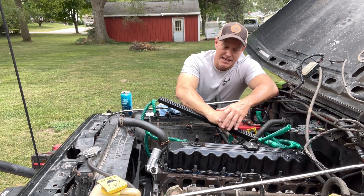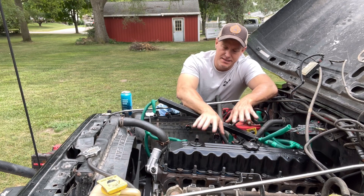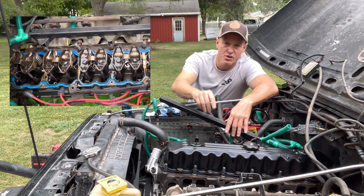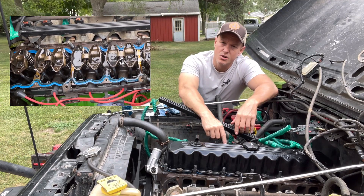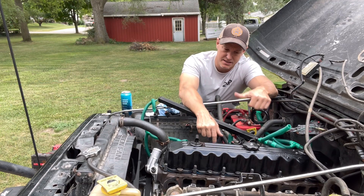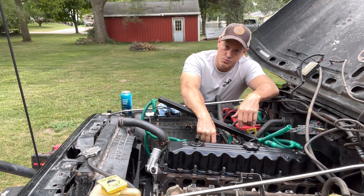It only had 20 miles on it. So what I'm thinking is that the spring on it was just not good. So we're taking the top half of the motor apart. If you look at the video, it'll show you right here — the lifter valve is not opening and closing. What we did is we did a hand crank on the motor, and the lifter was lifting inside because I held down the push rod. So I know the camshaft in there is working.